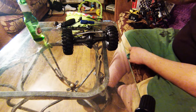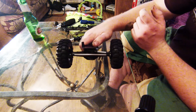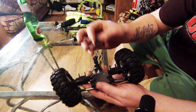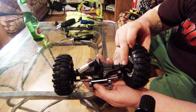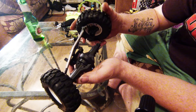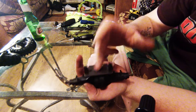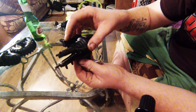Welcome back. So there's my standard Maverick Scout axle. As you can see, you've got four bolts in there. You've got one on the back here which holds the three-link on - well, it's a four-link. Take that one out so you can pull that off. Then you've got one in either side of your C-hubs - there and there - and then in the front here and in the front there. Once you've undone all of them you should be able to pull that side off, and that side as well, and there's your wheels and your steering knuckles out of the way. This also applies to the rear axle, apart from you won't have to take the steering plate off.